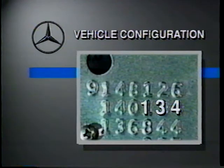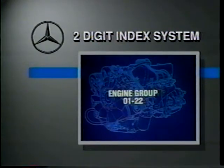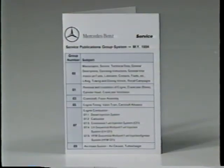The second three digits fingerprint the configuration of the vehicle and will change depending on the engine installed, the number of cylinders, the body style, and so forth. Now you have the model identification, but that's only half of what's needed to locate the correct fiche for replacing the window regulator. It's also necessary to understand the two-digit index system that Mercedes uses. In general, the system can be divided into three major parts, with groups 01 through 22 covering engine components and systems, while groups 25 through 55 cover various chassis-related systems and components, such as transmissions, axles, brakes, and steering, and groups 60 through 98 covering the body — which would logically include the window regulator replacement. After a while, you'll become familiar with the group system, but in the meantime, this pocket reference card will be very useful to you.